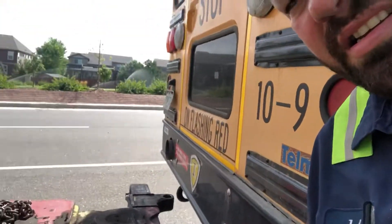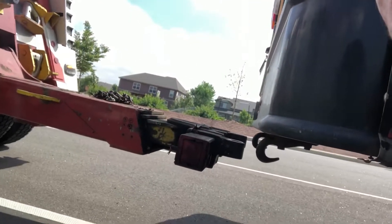The first thing I'm going to do — I always preach safety, safety, safety. It may seem a little redundant or ridiculous, but I always like to take the underreach and put it behind the bus or whatever I'm towing. It's not on it, not touching, not lifting, and it won't hit when the suspension goes down. But if for some reason I pull something off underneath this bus and it decides to come backwards, my truck's going to catch it and it ain't going to run my ass over.